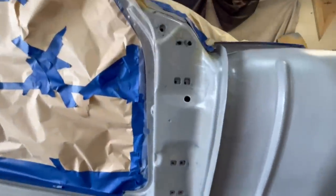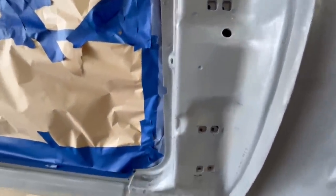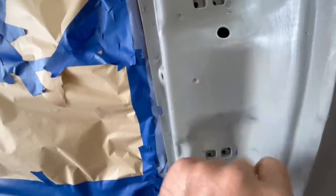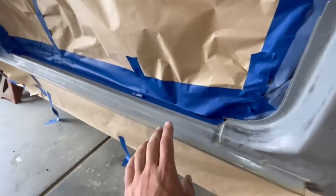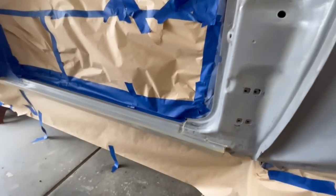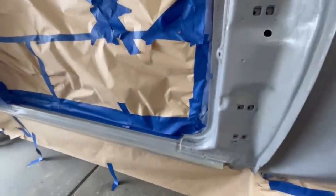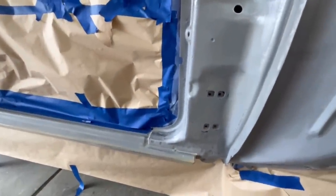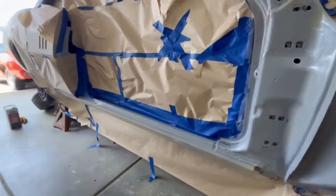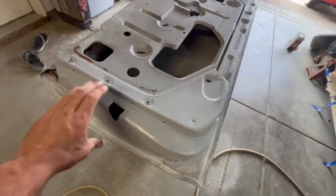If your eyes are sharp you'll see little spots of bare metal here and there — not the end of the world, it just barely sanded through because this is only one coat of epoxy. I didn't do a whole lot of body work on the door jamb. They're all sandblasted and prepped. What we're going to do first is put a sealer coat on and cover up this entire area. We're going to use one coat of epoxy reduced with a little bit of acetone — that makes it a sealer coat. Hit the whole thing with a nice sealer, let it sit about 20 minutes, then put our base color on and do the same thing to the doors.